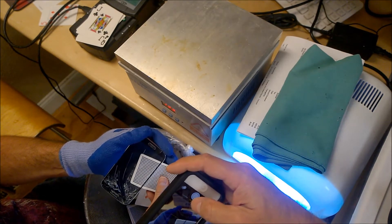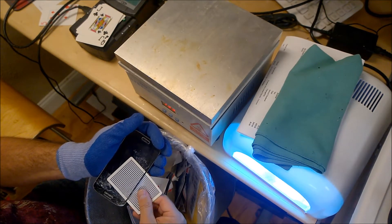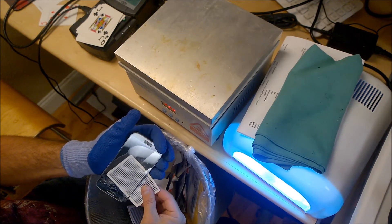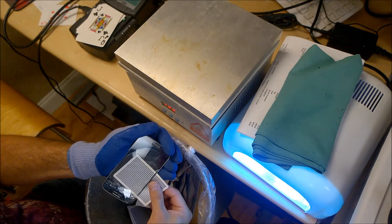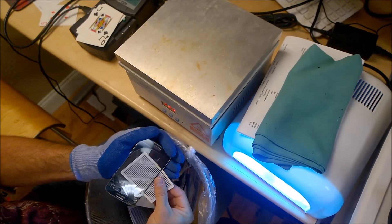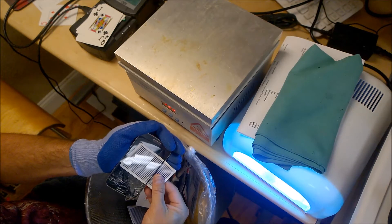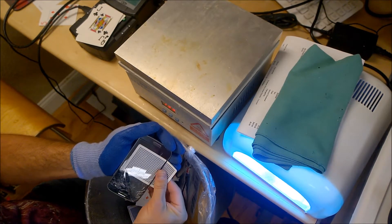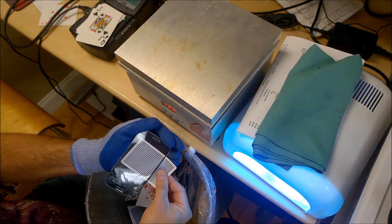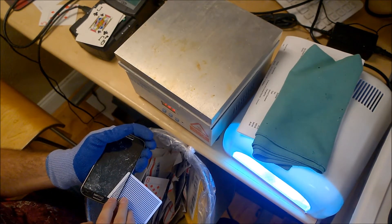This is kind of a behind-the-scenes video. I wanted to do this during an actual repair and have all the equipment in the camera shot. This is the best way I found to do this. You can see here the digitizer actually separating from the LCD right where the playing card is, and he's just working his way very slowly and gently. With enough patience, you can get the entire piece off. You do have to be careful down at the bottom near the home button because those soft keys sometimes stick to the lens, and you do not want to cut through them.